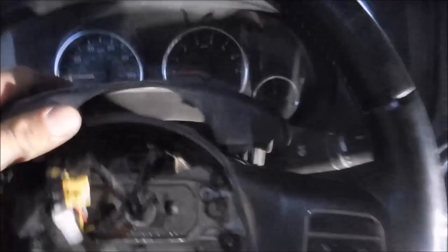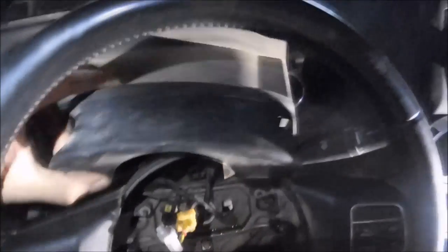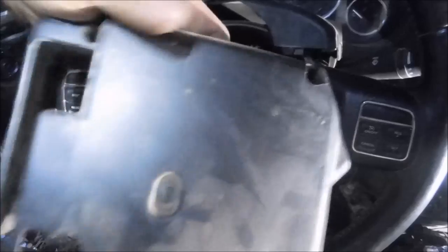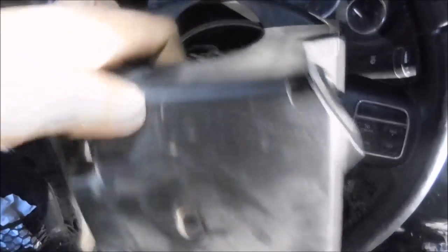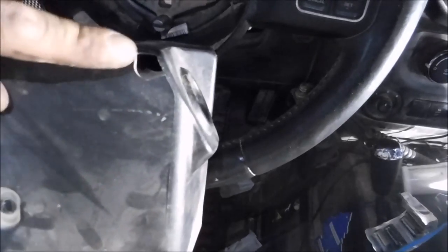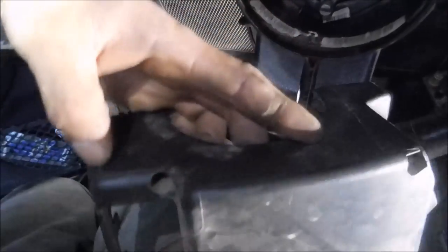The steering wheel itself has a little punch that shows the top, and the shaft itself with the splines has a little dot on the top as well. That's how we're going to line it up — I'll use a paint pen to emphasize that point. There are splines on the steering wheel; there's a small gap on the bottom and a big gap on the driver's side. That's just going to show us the correct way to put it back in. Next, I took the top shroud part out and the bottom part out. There are three T20 bolts that hold it together — one directly on the bottom and then the other two are in those two holes.